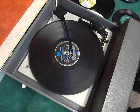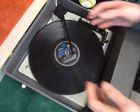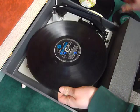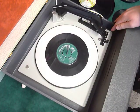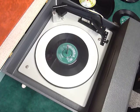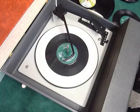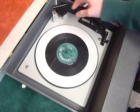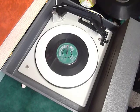If you don't want to use the auto changer and just want to play one record manually at a time, you can place an individual record down the spindle onto the mat like so. Leave the stacker bar up and select auto, or you can select manual start and place the arm onto the record yourself. Once the arm is on the record and it's playing, lower the stacker bar down so it knows to switch off at the end, or leave the stacker bar up to enable the repeat function and the same record plays over again.